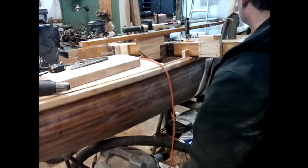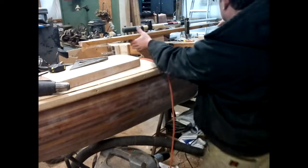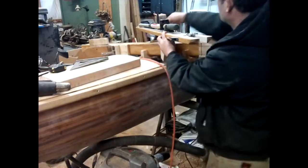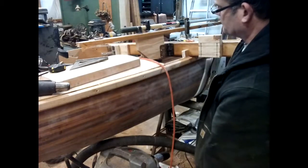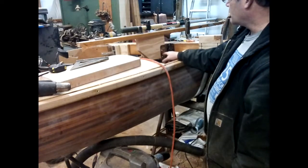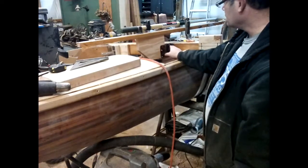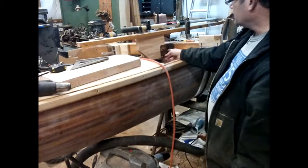I have to get the hinges before I can do the crossboard, but I'm liking this — it's going to be good. There's going to be plenty of room under here and it's not really going to get in the way. This Yakko will be permanently affixed to the boat. The motor's going to be here, and I can go way over completely without hitting the motor — yeah, that's going to work. I need to get three strap hinges and come up with some sort of board — I'll probably just go with Doug Fir. These guys right now are just temporarily screwed on with drywall screws; I'll probably go with stainless, or maybe even a through bolt. There are eight fasteners here, probably number 10 countersunk — that'll be pretty strong. On the other side since there's only four I may go with a small through bolt.